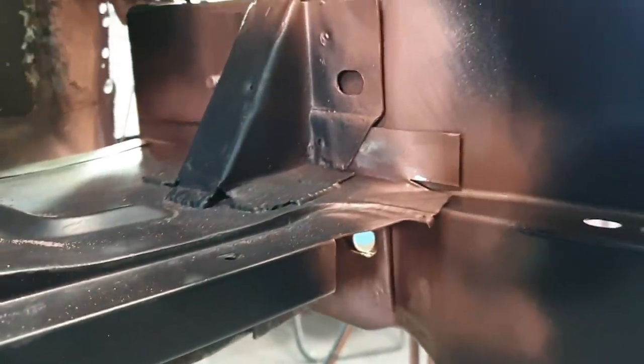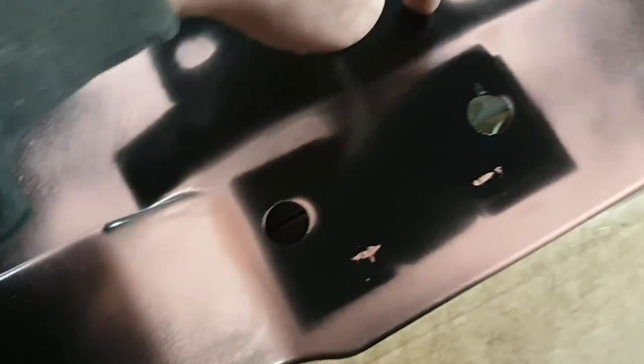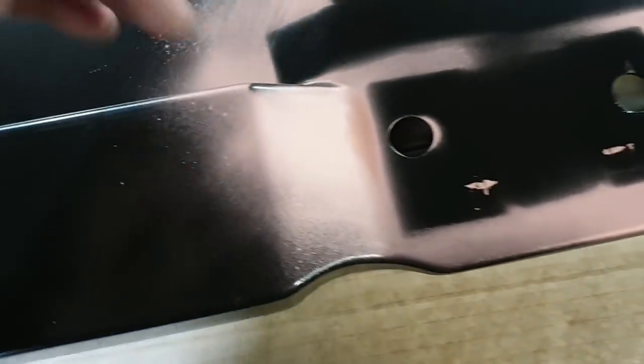Right. That is one way to very quickly work out where I need to clean bare metal, because you get a perfect outline if you haven't already figured that out. All right, and there we have it. Look at that. And then you just go drill, drill, drill, and then two, two, two, two, done. Wipe it off with my finger, and then we have it all ready. I'll drill the holes first because I've got a perfect outline, and then I'll bare metal it, and then cop spray it again, where the welds are going to be.